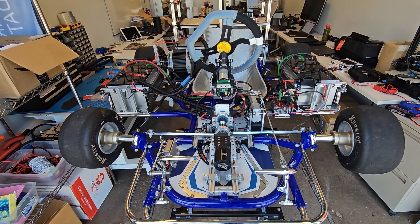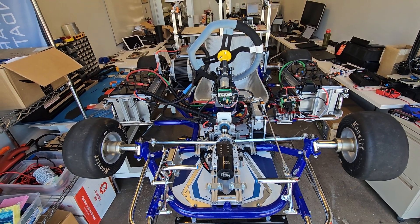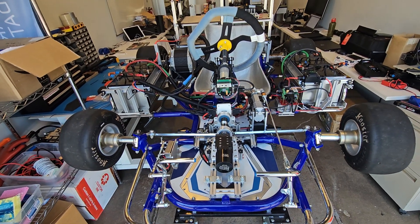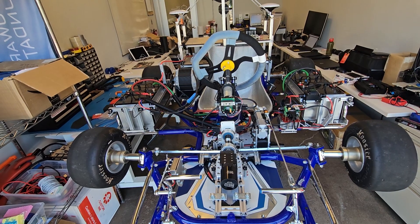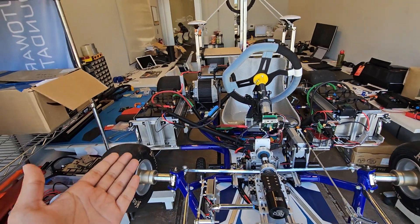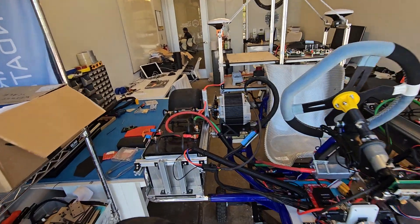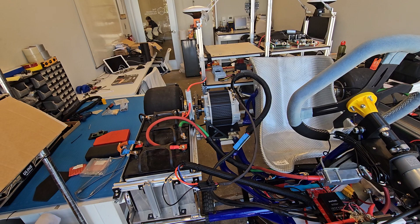The vehicle is purchased from Topkart, which gave us the basic pedal-controllable go-kart system, and we've modified it by adding several subsystems and control systems that make this car completely autonomous. We have battery packs on either side — six batteries total, four of them providing power to the motor, which is a brushless DC motor purchased from Electric Motorsport.